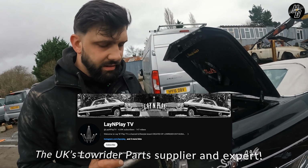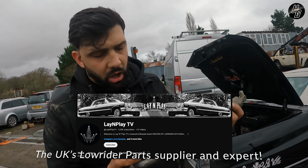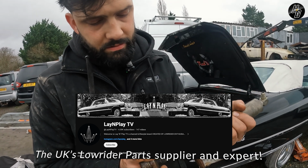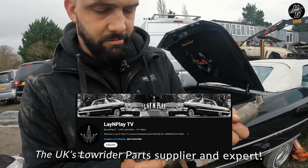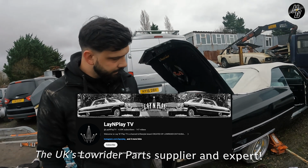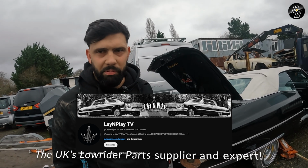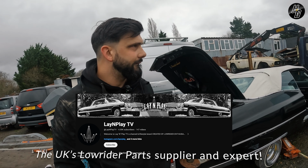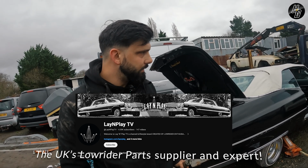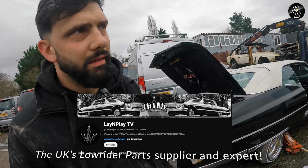Yeah, and to be honest with you, mate, there's quite a lot of play in this ram. I'm grabbing hold of the ram. If there's play in it, it should go up. You should be able to hit the switch, and it should go up. It doesn't make any sense that it's not. I would suggest that if it is operating and fluid is going out the hose, throw it back in and disconnect the other pump. It's more than likely that something's wrong with it internally, and although it's blowing fluid out, once it's under load, under pressure, that fluid could be recirculating back to the tank.